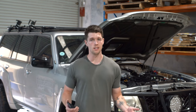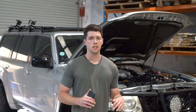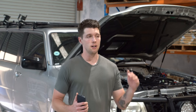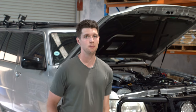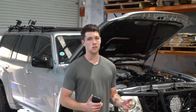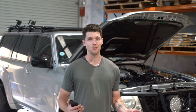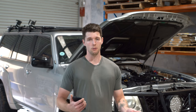The other issue I had was my high EGTs, or high exhaust gas temperatures. Prior to the installation, I went on the highway driving at 100 kilometres an hour on a slight incline, and I was averaging 450 to 500 degrees on my EGT gauge. That's obviously very high — 550 is probably the limit for me, and I was hitting around 550 going up hills. Driving the car now with the new system, my EGTs have dropped by around 50 to 75 degrees. I'm starting to average around 400 degrees in the exact same conditions, and I even saw it go as low as 375. The EGT probe itself is installed post-turbo on the dump pipe, so I hope that gives you guys a little reference point.